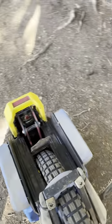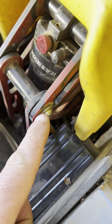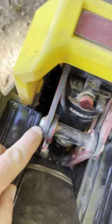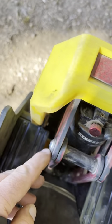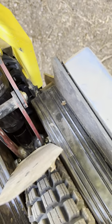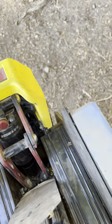Number one — there are little bushings in here. You can kind of see my fingernails on the bushing. I added these washers because all the bushings were half out and there's too much play in that pin — the head of the bolt is not big enough to push on the bushings like it should. So it was all sloppy and falling apart. That really tightened it up, except for the top pin that goes into the frame, which you can't adjust the spacing on. That bushing's out a little bit, but it's the least of all of them.